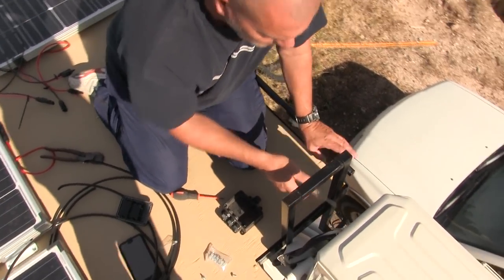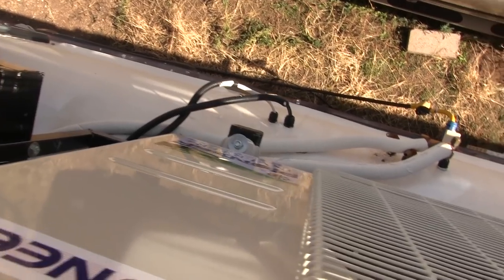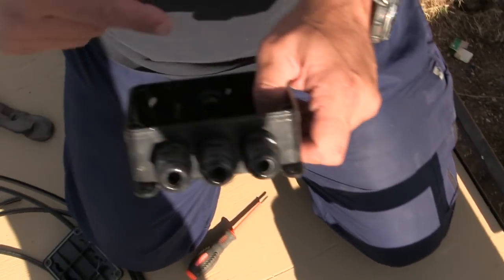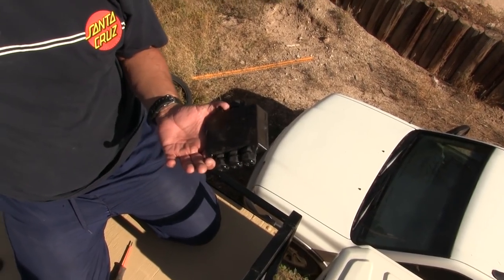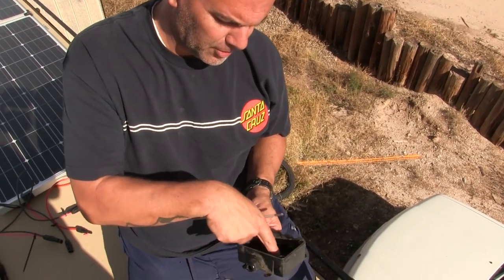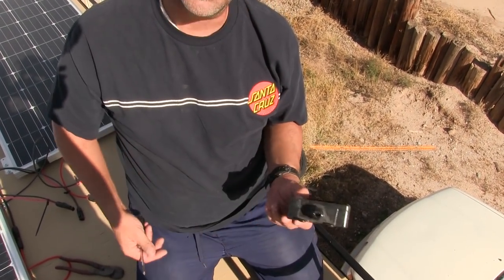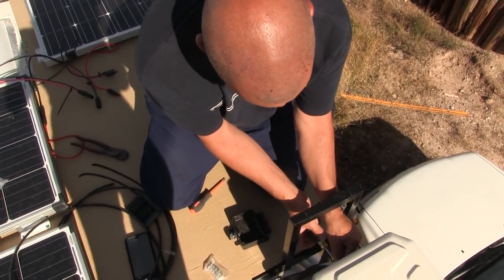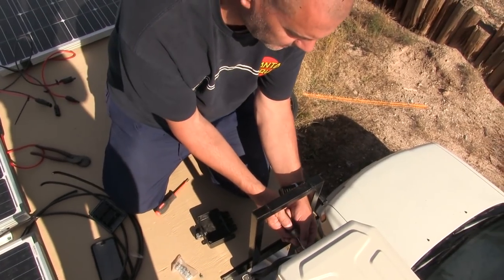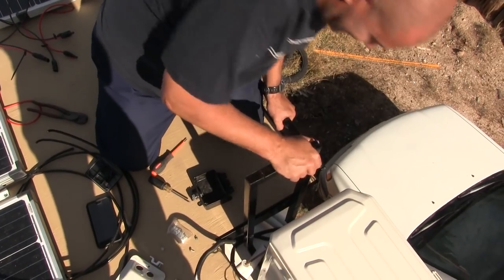So right here — if you look down here, this is how I'm doing the pass-through for our air conditioner right now. I'm going to consolidate with this — it's a four-position cable gland. I'm going to drill a hole through this and screw that onto there, but we're going to goop it up with silicone or butyl tape so when it smashes down it creates a waterproof area for all our cables to pass through in one place. We're creating our own pass-through since that completely useless RV shop down the road doesn't even know what a pass-through is. We're going our own way.